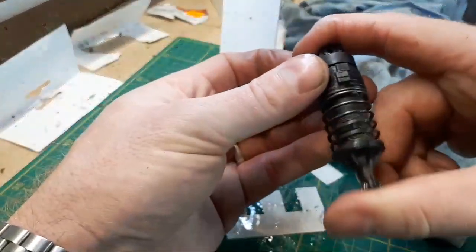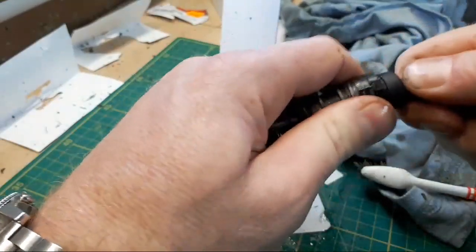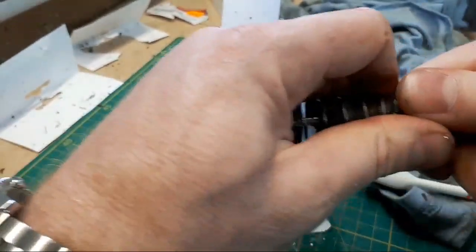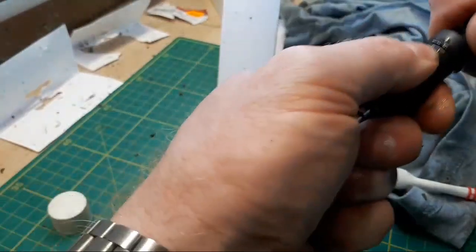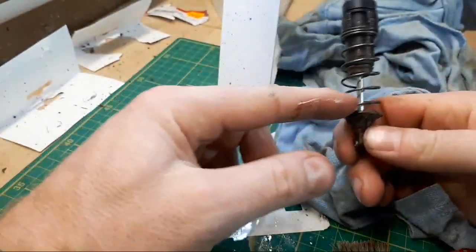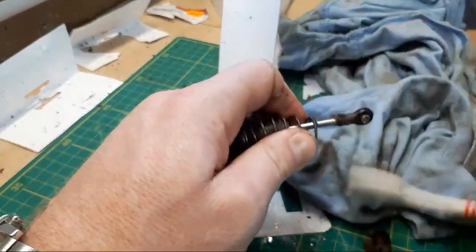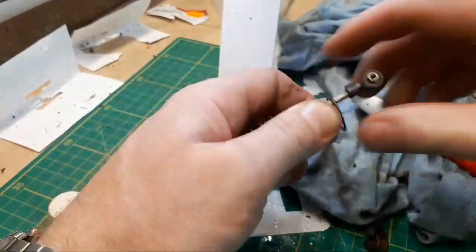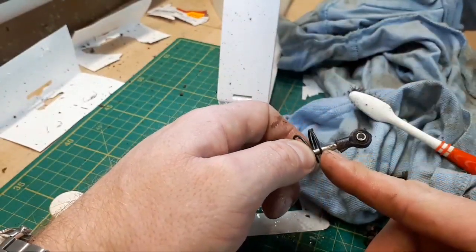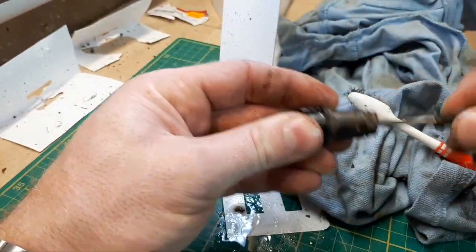Let's have another go. They're definitely working nicely now, but is that a shock cap on there? Oh, there we go. Go right down. Fantastic. What I might actually do to save these shocks from doing this again, another trick you can do, so the shock doesn't bottom out, is get a little bit of nitro fuel tube. Pull off the bottom of the shock. Look at the gunk. Twist the end off, and put about 5mm of nitro fuel tube over that, so that this part doesn't bottom out. Literally just stops there.